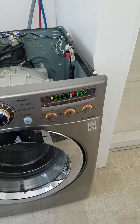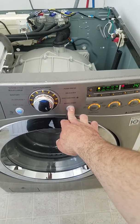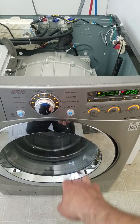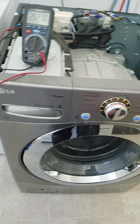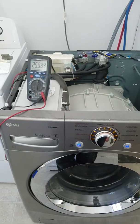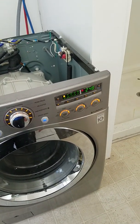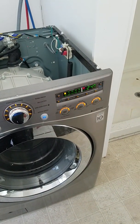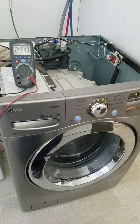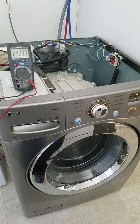Make sure it locks. The door lock on this is sometimes a little wacky. So it's filling up, and the sensor would respond fairly quickly. So it really wasn't an issue with the sensor responding to it filling — it was when it was draining that the sensor wasn't reading at all.